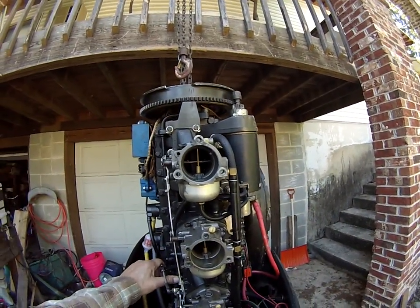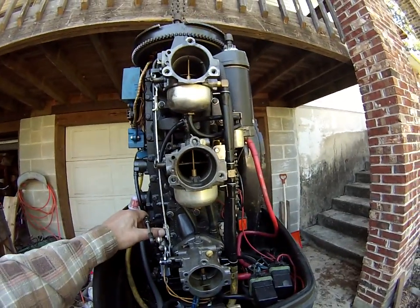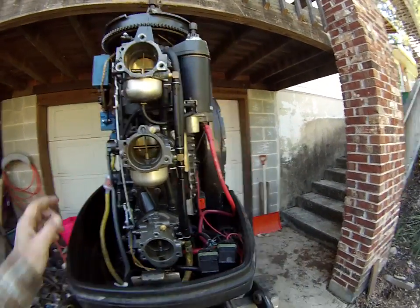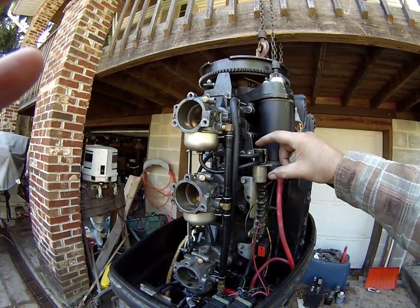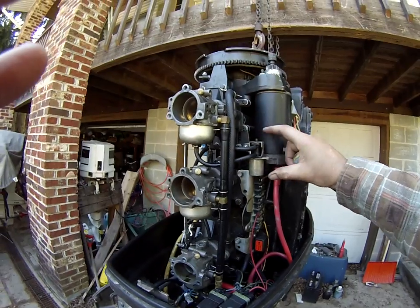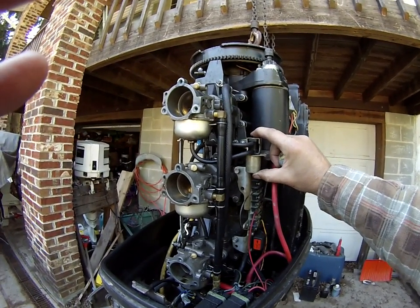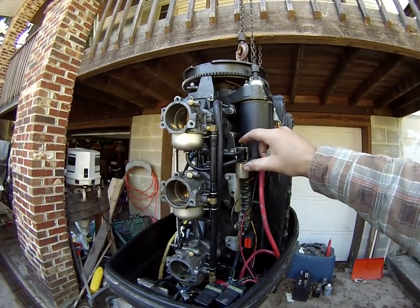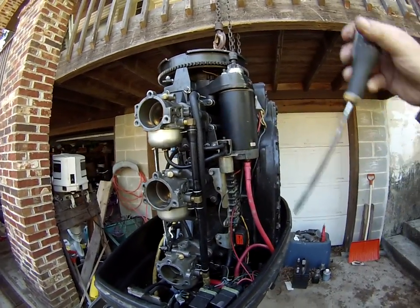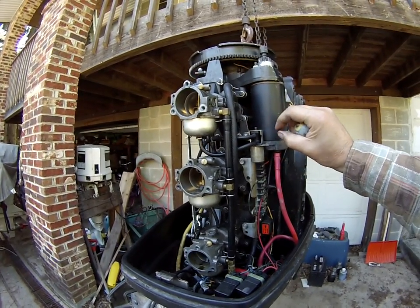You can also see that all three carburetors are opening fully. This particular engine does not have a choke — it has an enrichment valve, and this is the manual override if the electric doesn't work. For whatever reason, you press this black button. This enrichment valve must be mounted on a rubber grommet; otherwise vibration will cause it to flutter open and close and give you running problems.